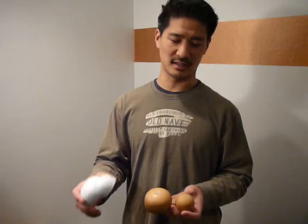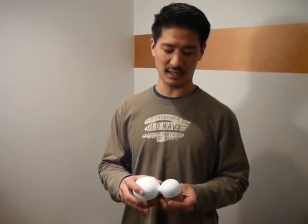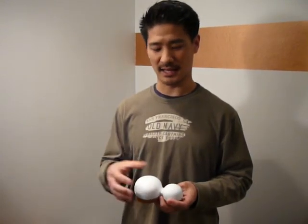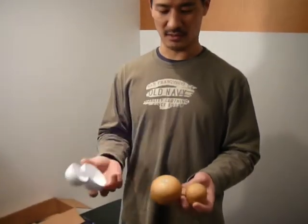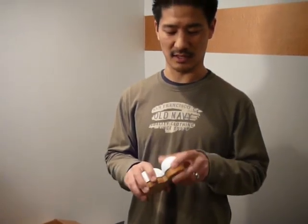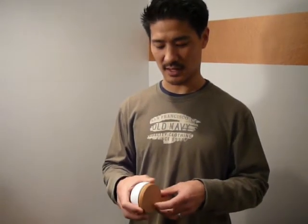Heat up the styrene in the same way. You can use a heat gun, or we have an infrared heating area, so that allows you to heat the styrene, and it sucks right over the shape. And then using the same technique, I trimmed the styrene with a router bit and a bearing, and that allows you to have a really clean edge.